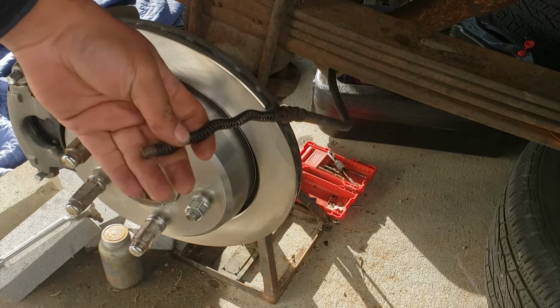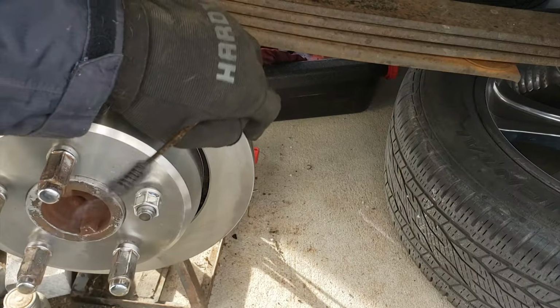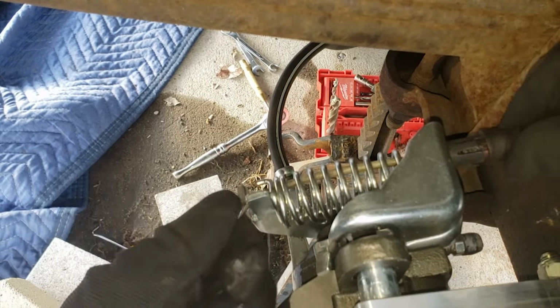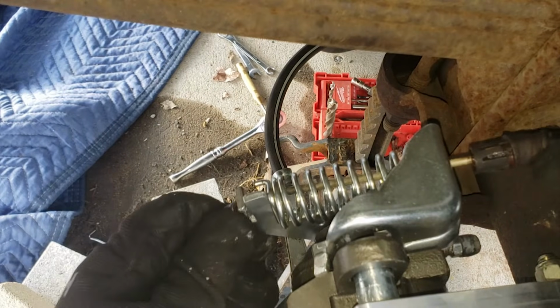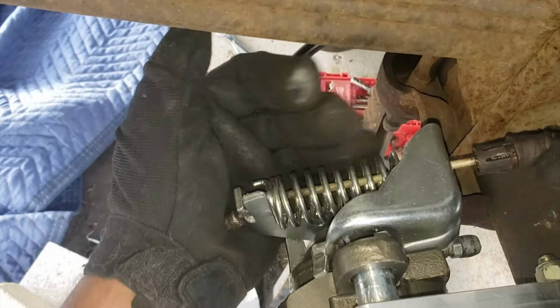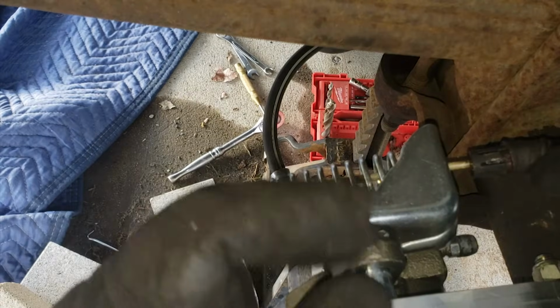At this point, I start assembling the parking brake cable. For the brake cable, cut this spring. I'm going to feed it through the back, through the spring. This will lock in, push it a little bit under the opening for this bracket. When you press on the parking brake pedal, it will pull the lever back using the cable, putting pressure on the pads. Once you release it, the spring will push the lever back to its resting position.